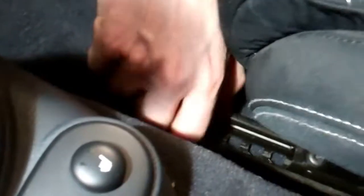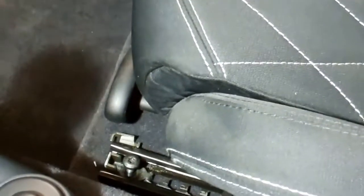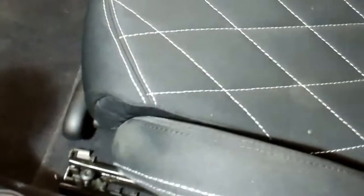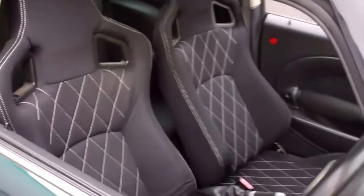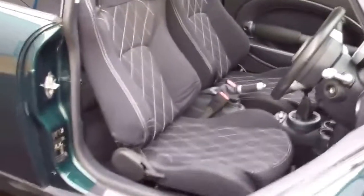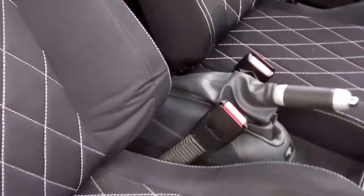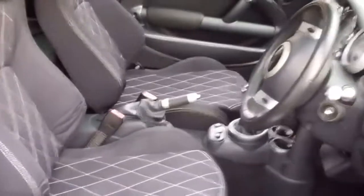You can see four bolts go down through the runners, and then we slide the seat forward slightly — all the way forward — to get access to the back two bolts. Here's a little demo of the bucket-style seats we've fitted in the BMW Mini. These come complete with a subframe mounting kit. They reuse the original factory sliders and original seat belts, and they slide really easily backwards and forwards — just like the original BMW setup.